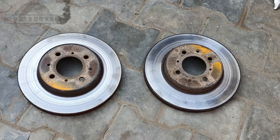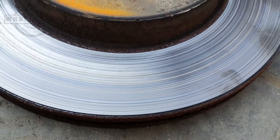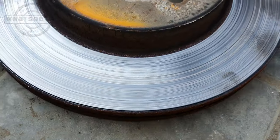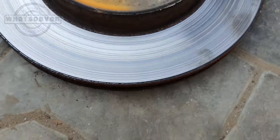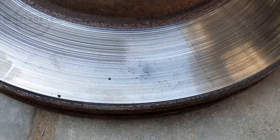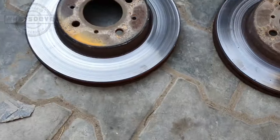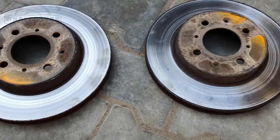This is where it is guys — we have got two discs. Check the grooves in it. There are so many lines and grooves, and the discs are very worn. In the groove, there are also grooves in the disc pad, and when we brake it, there is a lot of noise. Now we will trim the disc on a lathe and I will give you an update when it comes back.